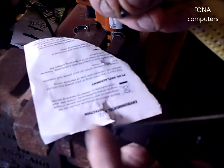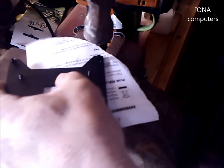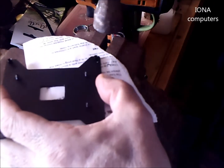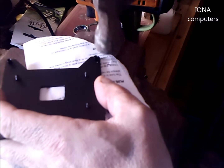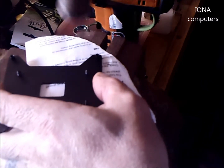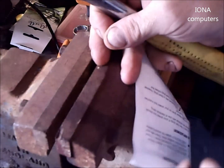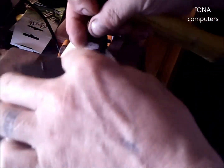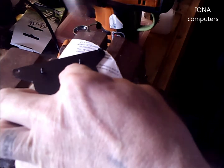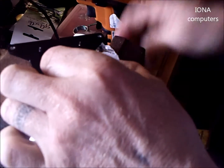That's the fitting — it's just pressed in. Same again with this one. You could probably get a piece of wood, drill a hole in it a bit bigger than the thing, and just put this onto a flat piece of wood and tap it through, or whatever you do. Just want to make sure that you're not deforming the shape of the plate. Tap this one out nice and gentle — doesn't take much to come out, and we're done.